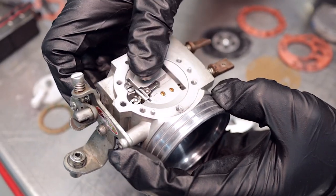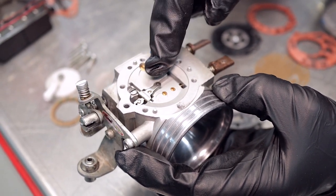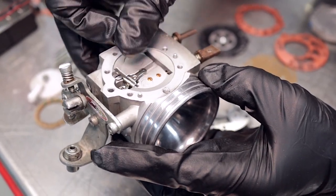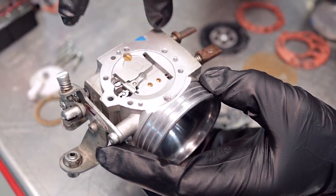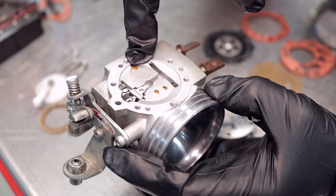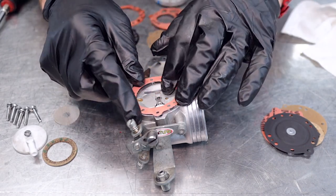This one is in pretty good condition — it's just coming in for the half-year service so we're just putting a gasket kit in it. The lever has been bent up a little bit above the body, giving slightly richer conditions in the float bowl chamber. You can see the main jets — the high-speed circuit and the low-speed circuit down through the dump tube. Now we can reinstall the new gaskets in reverse order.